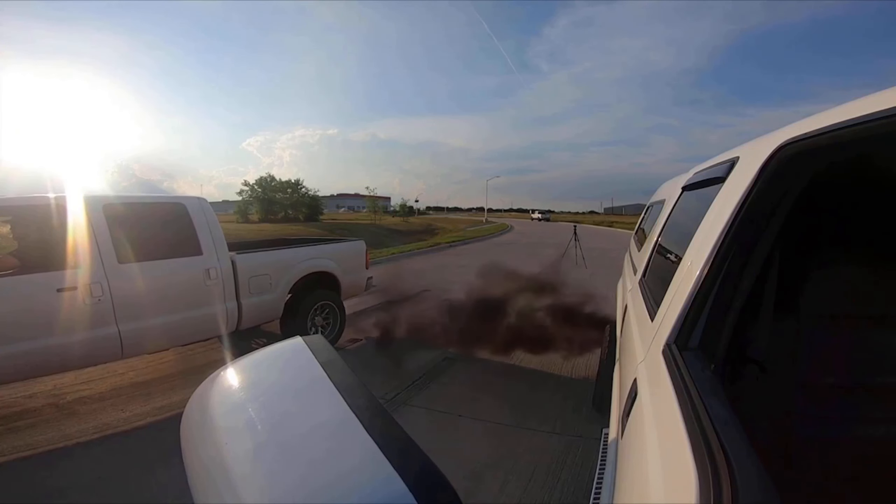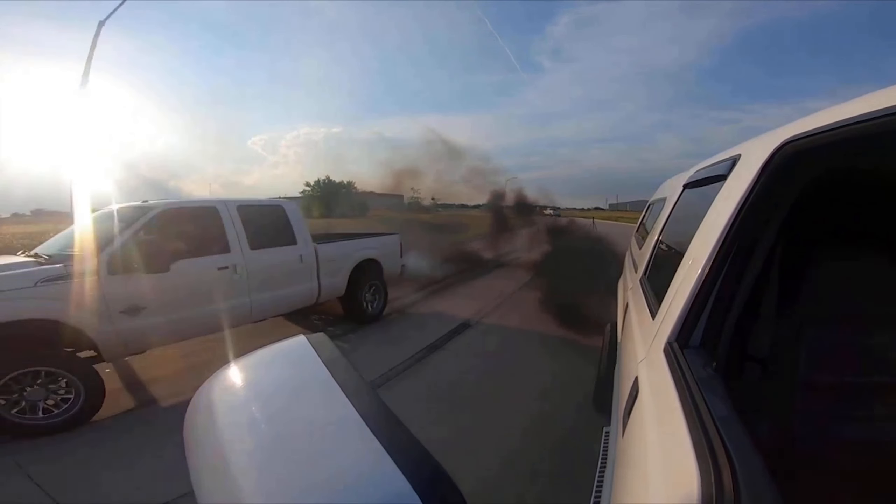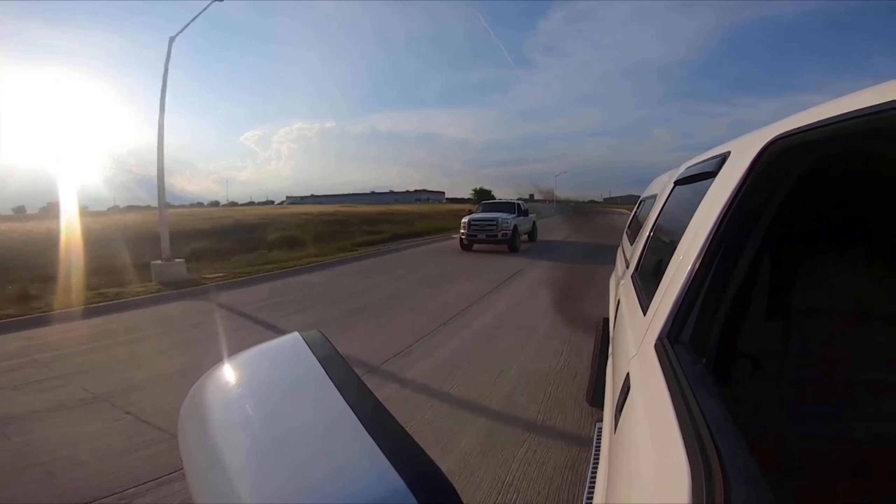If you really want to push the limits on these 6.0s and go the extra mile, an upgraded turbo is a really good one to start with. KC Turbos make some great turbos — they have a great stage two turbo you can put in on your 6.0. Throwing in a stage two turbo is going to put you easily at that 550 range. And if you wanted to go really wild with your 6.0, you could put some upgraded injectors in there too — if you put stage two injectors and a stage two turbo in, you're looking at probably 685 to 700 horsepower.